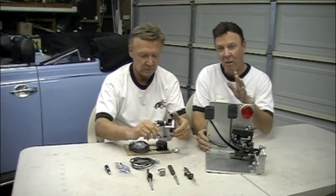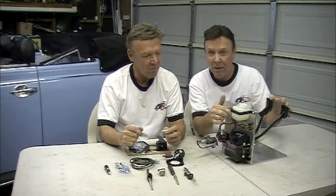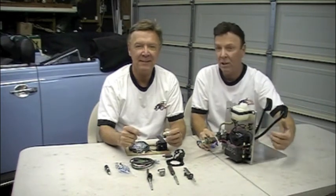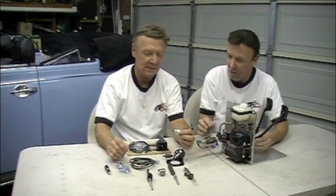Let's go back and look at what's on the car so everyone can understand exactly what the classic Volkswagen has. We have a classic Volkswagen behind us here. We've taken a pedal assembly out that's similar to what's in that car and mounted it on this display. Here's a master cylinder in the back, a battery hooked up to it, and here's a reservoir — so it's going to function like what you see in the car. We don't have the wheel cylinders or brake shoes, but it's all wired up. I have two electric switches here: one goes to the original setup and one goes to the smart brake light system. This switch on the back of the master cylinder is your brake light switch.